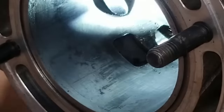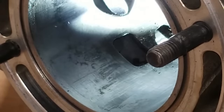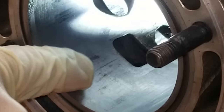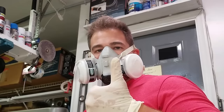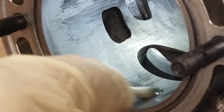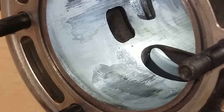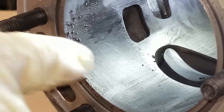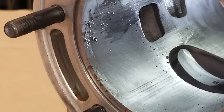I put a flashlight in the other end to give a better view into the cylinder. Being careful not to get any acid on the outside of the cylinder, since that's cast aluminum and it would eat it away. That section is looking pretty good — I can actually see the cross hatching again, which is awesome. The small imperfections should come out with the ball hone. I've put on a gas mask at this point because this stuff was really starting to stink.